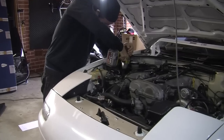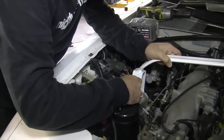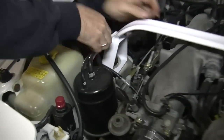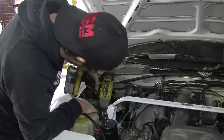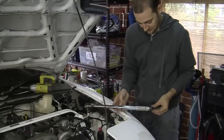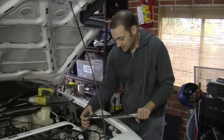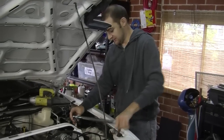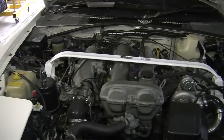Now, the most common problem when installing these is snapping the studs on your strut tops, which sucks. So use some WD-40 and be really careful when removing the nuts. This is probably one of the easiest mods you can do to just about any car. Just make sure you get one that will clear the various bits of the engine — some go right back to the firewall, some are adjustable, and some have more than two points of attachment. Do some research to see what's best for your own model of car. You gave me this torque wrench for my birthday a couple of years ago. Yeah, it's a great present — saved many a bolt from destruction. You can get torque specs for your strut tops from a service manual or jump on Google.